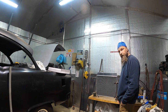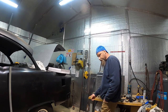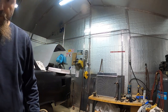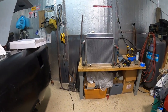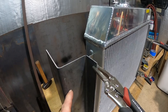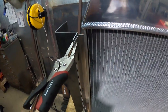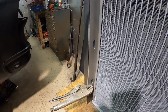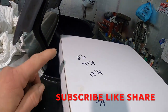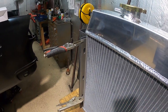We're going to play around with the radiator today. My buddy Neil bent the brackets for us and they look like they're going to work out good. Let me show you what we got: our plates are bent, we got an inch and a half lip, coming over three and a quarter, then about four inches. I measured to the center of each slot — the first one comes down two and a quarter, the second at seven and three quarter, and the last one thirteen and a quarter, all in to center three quarters of an inch.